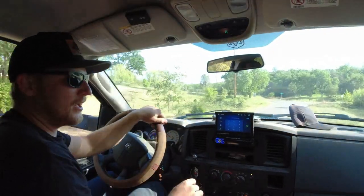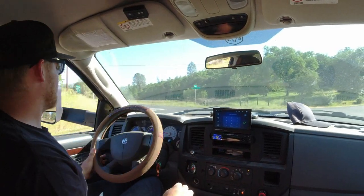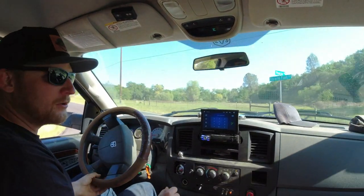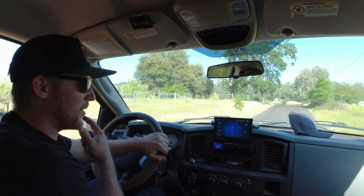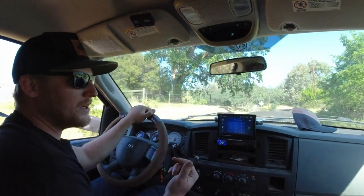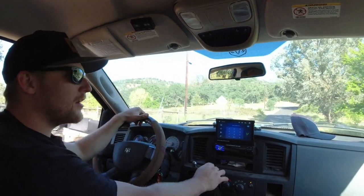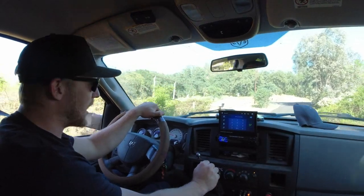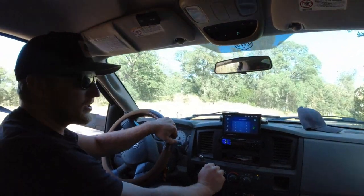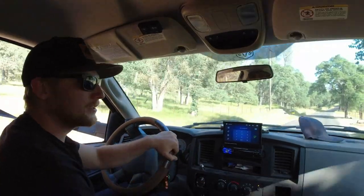The trailer has suspension and everything, but then the tires — you can see the tires just taking a lot of the heat. You can order a trailer from factory with the upgraded 16 or 14-ply tires, which is typically what I've been doing on my later trailers, but I hadn't tried it on the 16s yet. I went the cheaper route so I didn't have to buy new wheels — I got the higher ply on the 16s just to try it out. I don't know what's gonna happen to this trailer, but I want good tires on it for now and I don't want to put junkers on it if we sell it. Feels a lot better though, very much worth it.